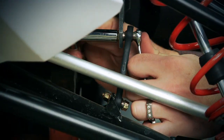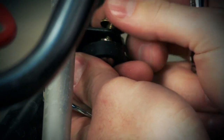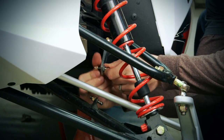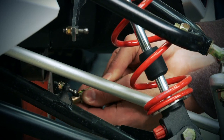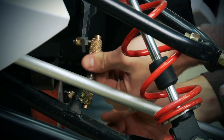Skidoo offers a bolt-on quick disconnect sway bar kit that allows you to disengage the sway bar in about two seconds using cam lock style fasteners. While you can just take the sway bar off altogether, it will negatively affect your trail capabilities. With this installed we'll be powder hooking like rockstars and experiencing the best off-trail front end performance possible, as the disconnecting of the sway bar allows each side of the front suspension to articulate and move independently of the other.